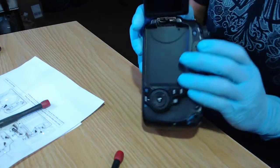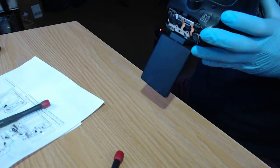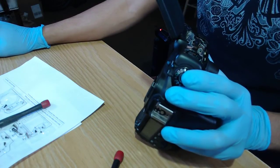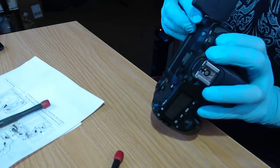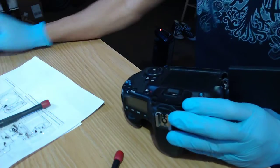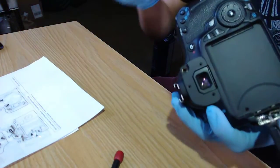Screwdriver and putting it right on the edge here. And just lift just a little bit. Once it starts to come up, that's all you need. Now you may need to adjust the LCD screen just slightly as you lift it off. Oh, I see it. And be careful when you pick it up, because there's a flat ribbon cable connected right here. Just lift up on the edge of this connector and it'll come off. Okay. Okay. I see what we're doing now.